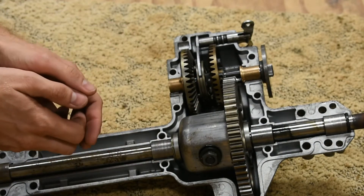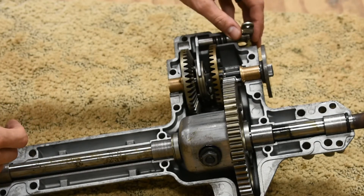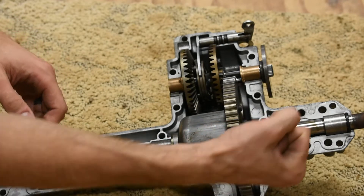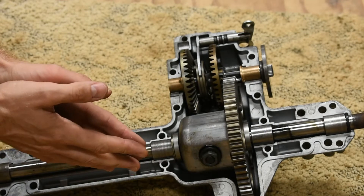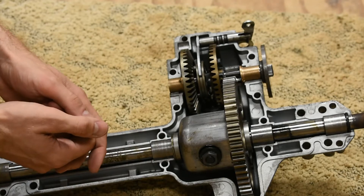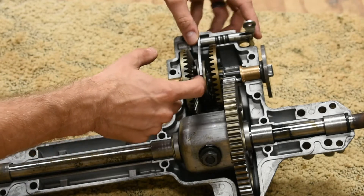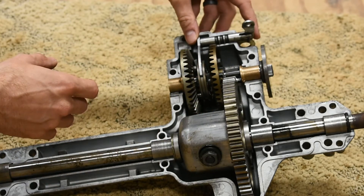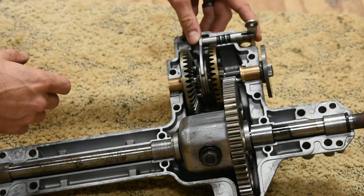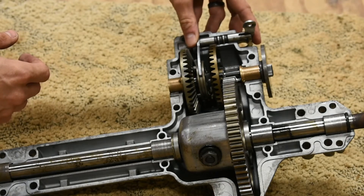Now there are three main pieces here, starting from the top going to the bottom. This first part is a sliding mechanism that's attached to the steering column by two steel cables, and that shifts it from forward to reverse — that's really the only shifting this transmission is able to do. Since there's no first, second, or third gears, only forward and reverse. There's a middle position, and we can see this little disc here. When we shift forward, middle, backward — there are three different positions that allow this to shift from forward to reverse or to be in a neutral intermediate position.